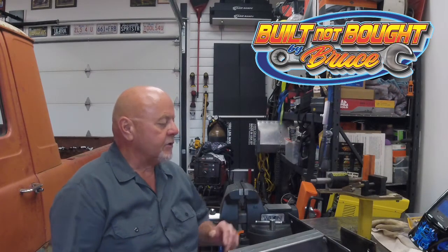I'll finish welding as nicely as I can — it'll certainly be strong. Then I'm going to clean these pieces up and put some epoxy primer on them. Then I'll weld the spring saddle on here — it'll be welded right to this piece, not bolted. Once I have that done I'm going to put epoxy primer on all of this, then use undercoating so that when I put it in there's undercoating between all the surfaces for good corrosion resistance.